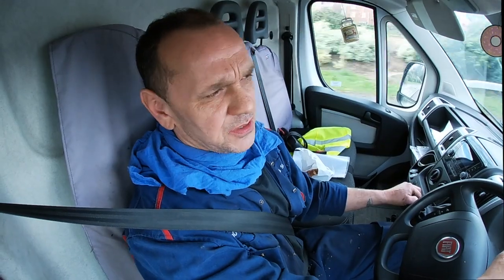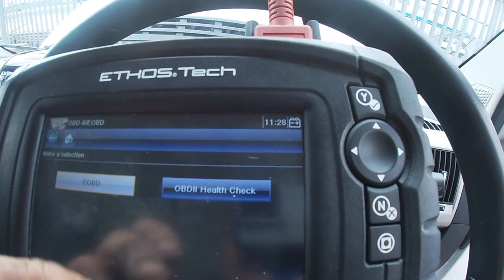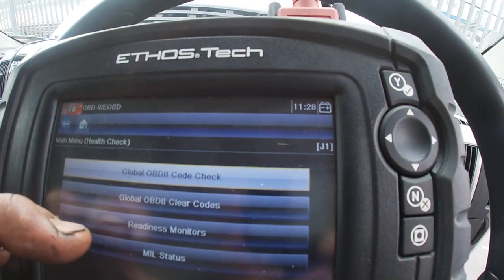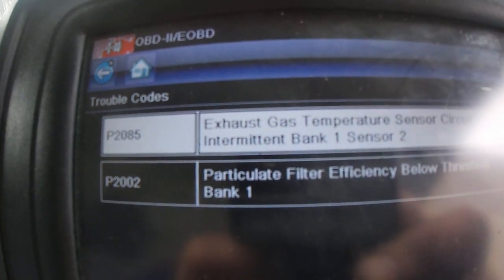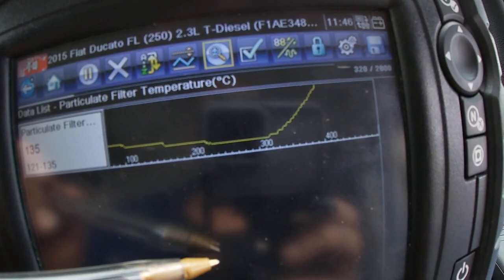Because it is on the powertrain side of it, you can go through into OBD2 — that's exactly what I did, because it seems to work out better sometimes as it comes up with specific codes. So I got the extra code, which was an intermittent temperature sensor.